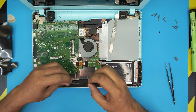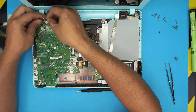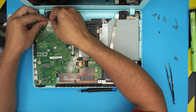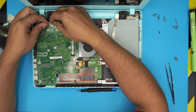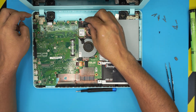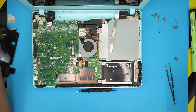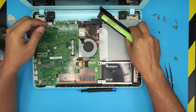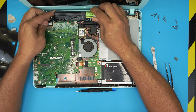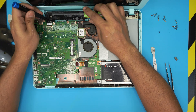Slide the DVD drive back in and put its screw. Grab the LCD flex cable and slide it in from the back evenly, making sure you push it all the way inward. Plug in the speaker cable. Grab the battery and scoop it down underneath the contact first, making sure it goes right underneath — you may need to lift up from one corner a little bit.